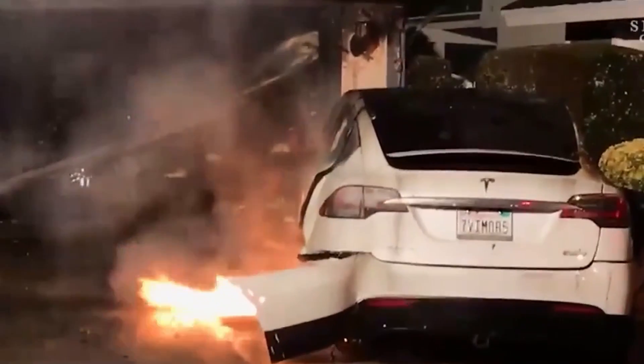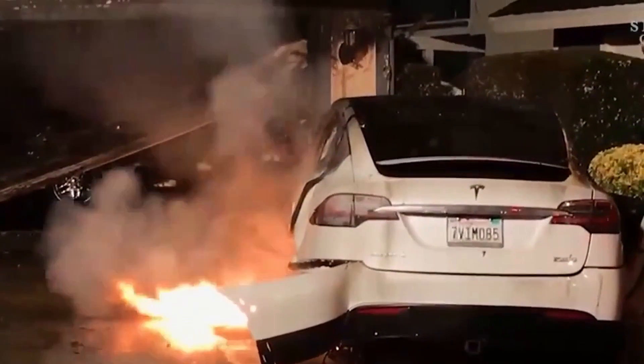At that point, take care of the exposures and let the vehicle burn. It's really unfortunate, but the best course of action for an electric vehicle, if that high voltage battery is on fire, is to just let it burn — let it burn through the entire battery pack. You should be on scene for about an hour to an hour and a half while that happens. Once it's burned through all the material inside that battery pack, a little bit of mop-up and a couple hundred gallons of water, and you'll be able to put the fire out and go back to your station.